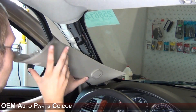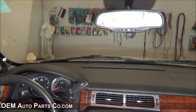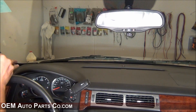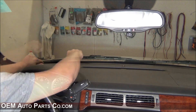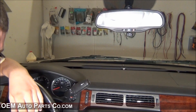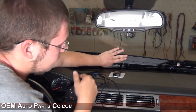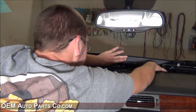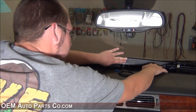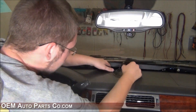Some models have a tweeter — you will want to disconnect this wire. Now remove the dash plate starting from the driver's side, working your way over to the passenger's side. Insert your panel tool underneath the dash plate by the clips and push up. Then grab your GPS antenna plate, lift up the dash plate, and you will see the location where the GPS antenna is inserted. It sits in there and one clip retains it.